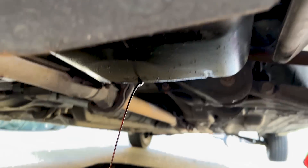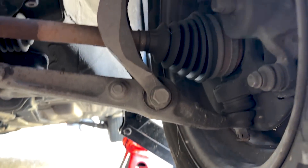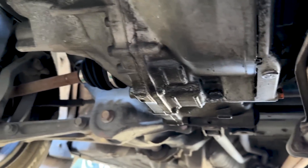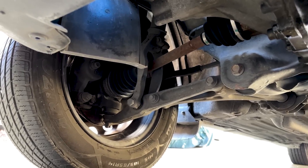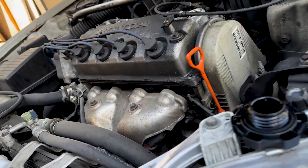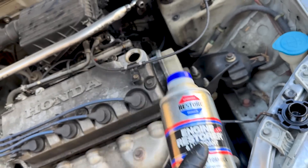Taking a look underneath - oil's draining. It looks like it's been leaking a little bit. I also noticed they replaced the oil drain plug. I looked at all the bits of the suspension and they look to be in excellent shape - axles are good. It's a very common place these fail, especially if they're not OEM. Looks pretty good underneath here, except over there I see a little bit of something. I really hope that's not the rear main seal, because that seals the engine to the transmission. I brake-cleaned all underneath - nice and clean. Look at that oil pan - flawless. For any high mileage, old car that's been sitting a while with low compression, you might as well just spend the ten bucks and throw in a high mileage oil additive - see what you get.